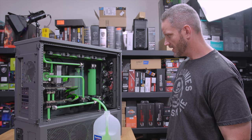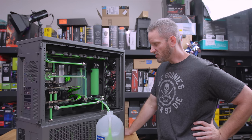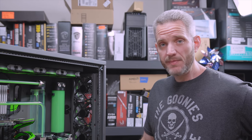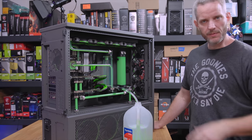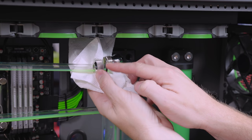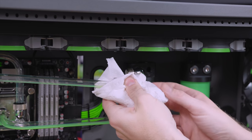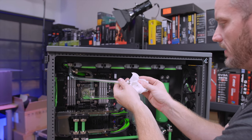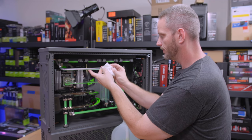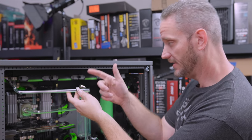Not bad, right? What I'm going to be doing is — if the blocks check out and there's no powdery residue, oxidation, or any of the nickel being eaten away — then I'm going to mix both of these fluids together so they're the same color and put it back in. Sometimes when you start dealing with powder buildup you'll see it forming on the O-rings, but this O-ring is perfectly clean. What I'm about to do is kind of gross — some will say you're blowing bacteria in there — but you've got to kind of blow your system to help push out some of the fluid.